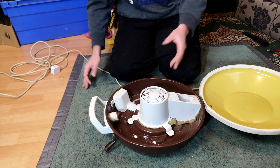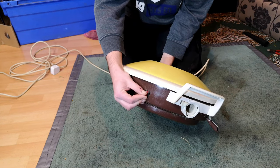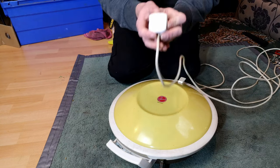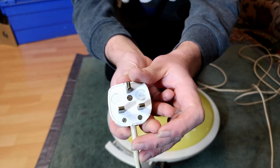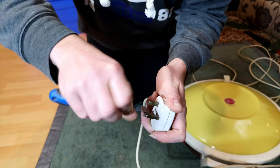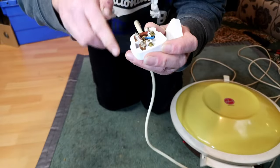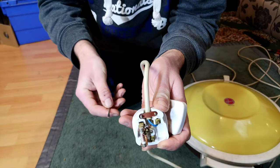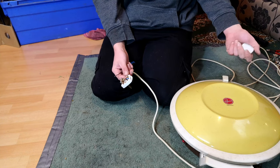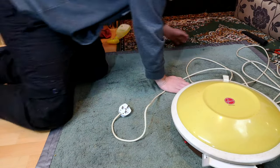We're not greeted with a humongous chunk of rust, so I guess that's good. The switch is always one to check - it clicks, and if it's all mushy or there's like a second click it's normally not great, but that seems fine. There are no massive gouges in the cable. We even have a quite reliable-looking plug - a nice retro Volex. There's probably not going to be anything wrong with the plug per se, but as any good fault-finding of electrical appliances should begin, we'll have a look inside. The live terminal isn't perhaps too lovely but it's sort of in there. I'll get the multimeter out and check the fuse - and yeah, nothing wrong with the plug or the fuse at all. She is completely and utterly dead, although the light didn't turn out so I guess that is a bonus.